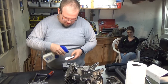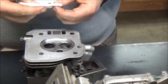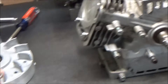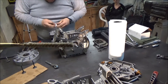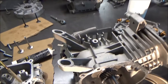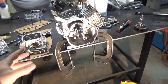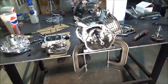Joey's just over here cleaning up the lapping compound. Like I said, it's virtually liquid sandpaper so you've got to make sure you get it all cleaned out of everywhere — just keep cleaning. These heads have a 5.5mm stem on the valves, which I find works perfect with a little swab you can get at Walmart. It's actually for a gun barrel for a .22 caliber — it's perfect to clean them out, especially if you have any residual lapping compound in there. You should actually start on the bottom end first and then do the head so you don't have any lapping compound contaminating anything, but I did mine first — be sure to wash your hands and clean everything.